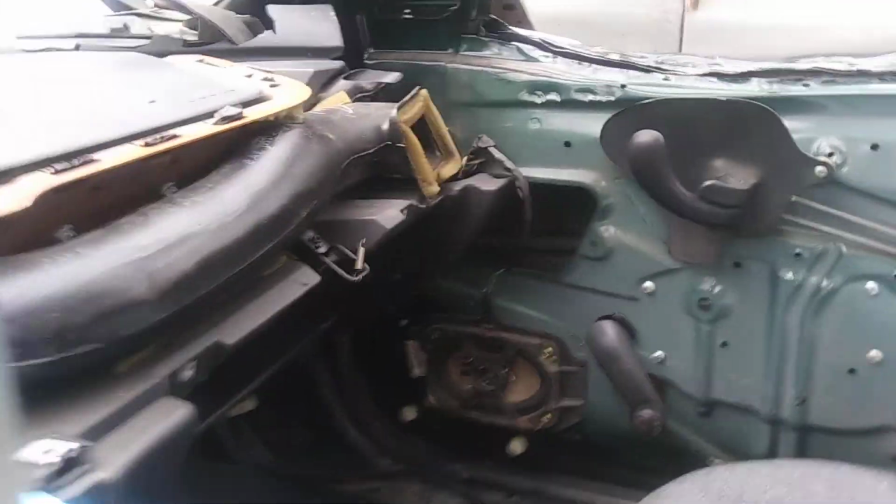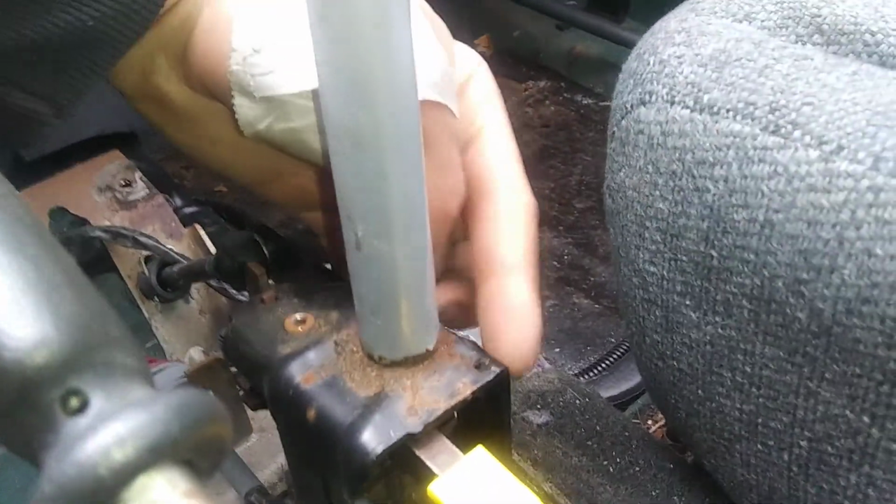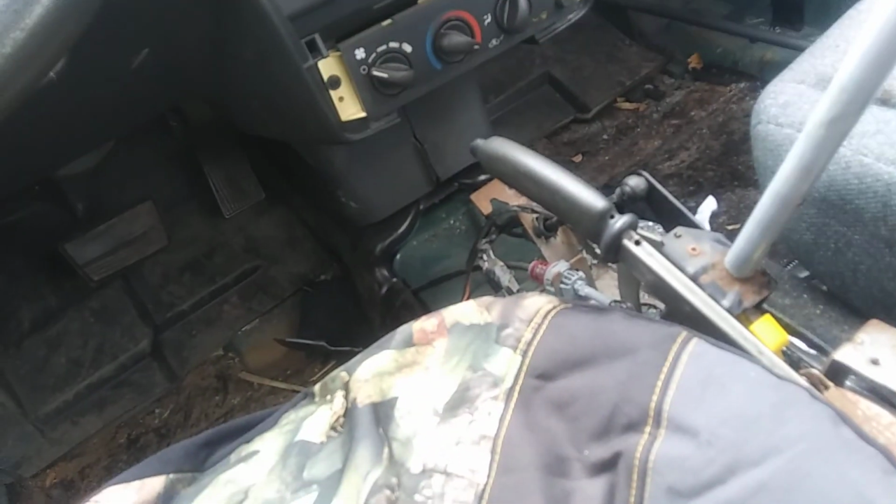Quick tip to make these Cavaliers a stick shifter. Slap shifter. He locked the doors on me again. And I can't unlock them because we smashed it down. But you guys see that spring sitting on the glove box latch? Right there at the tip of my finger? The end of it was sitting in this hole, and went down and latched onto the mechanism down there. But anywho, that kept it from going park, reverse, neutral, all that without pushing the button. Well, now, since that's gone, all the way to first, all the way up to park, and then when we get to the Derby, we're going to make something here, but there will be something that gets inserted right here.